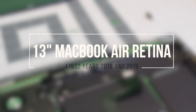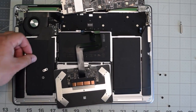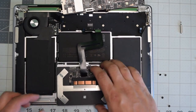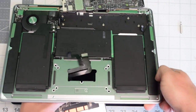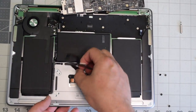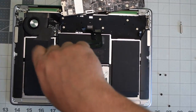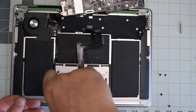Reassembly. When placing back the trackpad, you'll notice four little posts — go ahead and place those back as shown, then position the one in the center. Open up the Mac and slide in the trackpad cable in the correct orientation. Align everything and drop it down. Secure the center screw first, then wiggle and align the trackpad before placing back the remaining eight T5 screws.